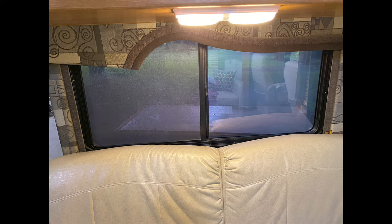I wanted to expand on something: you'll have gaskets on the inside of your windows, which means the cut of your tint needs to be a little tighter than the actual edges of the glass — to account for those gaskets. So if I hadn't gotten rained on, I would have cut it a little bit skinnier than the width of the window, just to take those gaskets and edges into account. I wish I could have filmed the cutting process a little more.